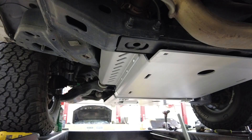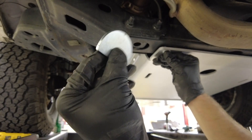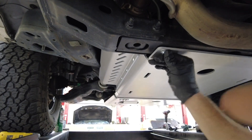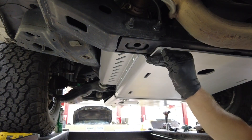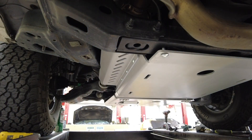On the back, we're going to put the bolts in. You can see there's a really long quarter-20 carriage bolt — go ahead and slide it up there. Then you want these half-moon-shaped washer-looking things, and you want the flat side facing the outside of the vehicle so it's not interfering with the frame. Slap that washer up there, don't forget the lock washer and nut — I forgot the first time and had to refilm. Put the nut on and thread it in. If you're going to install the transfer case skid plate, go ahead and leave these loose so you can slide it in.